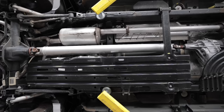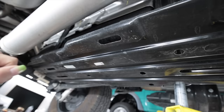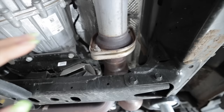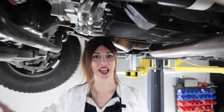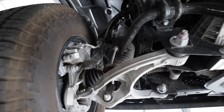This RAM has a ton of steel skid plates underneath because it's equipped with the optional 2700 backcountry package. This one being the 5.7-liter V8 Hemi with the mild hybrid system weighs in at just over 5,100 pounds. The skid plate is like five feet long — it's massive because it's protecting the optional 33-gallon fuel tank. The mid-mounted cross member is actually removable, as is the one supporting the back of the transmission and your Borg Warner two-speed transfer case. Up above is the ZF 8HP75 8-speed automatic transmission with a maximum torque input of 750 Newton-meters or 553 pound-feet.